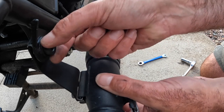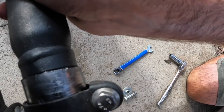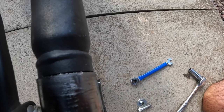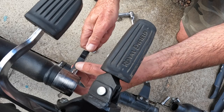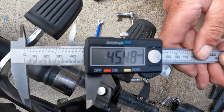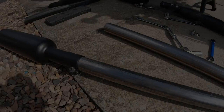Once I've got these off, the next thing is to measure the front pipe for its outside diameter and get some stainless pipe to replace the cat. 41mm roughly was the original diameter I thought, however it's 45mm with the gasket.